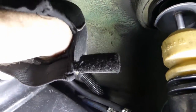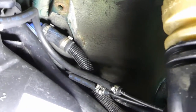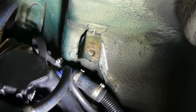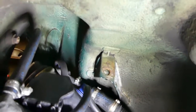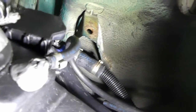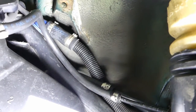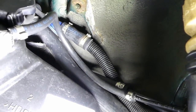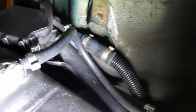My earlier concern about the hose getting pinched or rubbing against the sharp metal turns out not to be an issue, because the hose actually comes in front of the larger tube. There's a barb on the back of the tank that fits into a hole — easier to see on the old tank now that it's out. My recommendation: when putting this back together, look through the filler port and make sure you're not crimping the hose anywhere. I noticed during a test fit it was squeezing against the back of the tank. I'm going to grab some tie wraps to position this hose exactly where I want it so it doesn't rub against the metal connectors — and that should wrap it up.